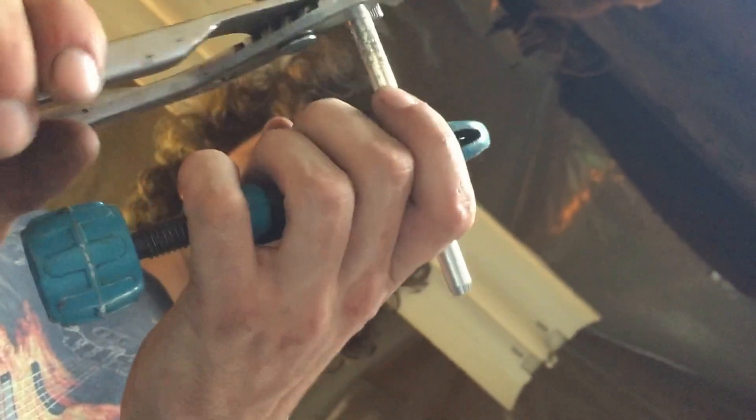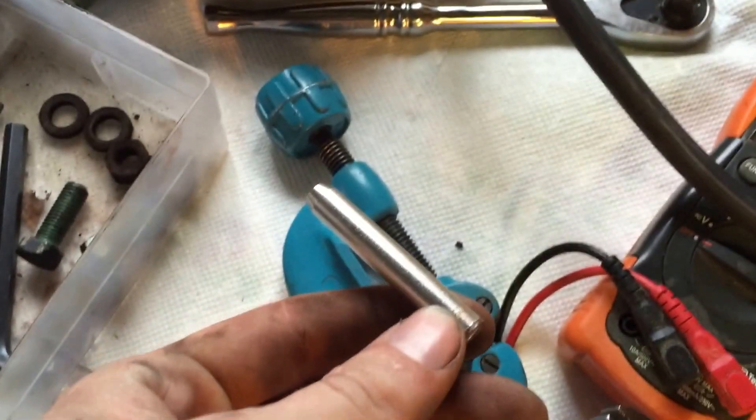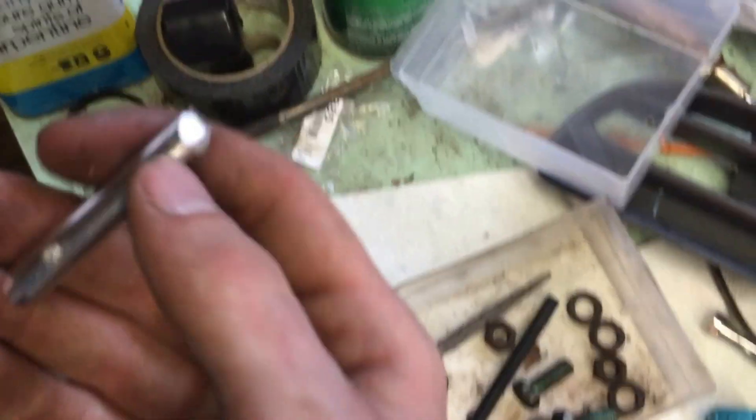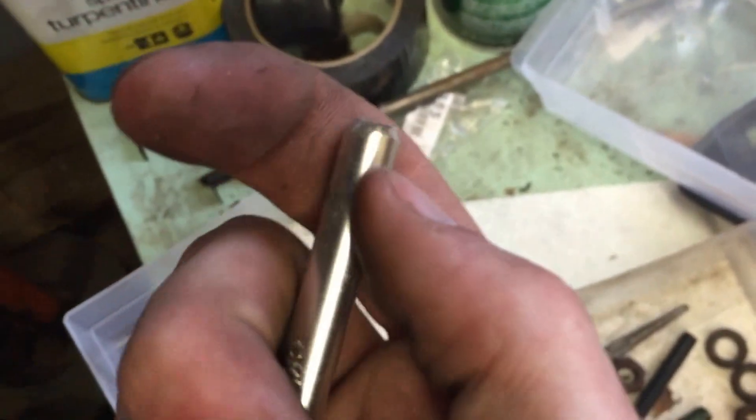If you're going to do this, definitely buy one of those little hose barbs — they're probably like 30 cents and that would have been the better way to go. I'm going to grind this down a little on the grinder. Now I know it's definitely aluminum — a lot of these grinders have 'no aluminum' written on the sides, and now I know why; it was just reflecting off and didn't grind at all. I'll try a file or a knife instead.